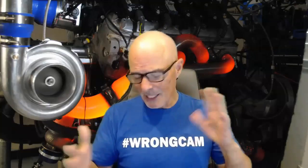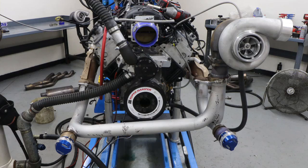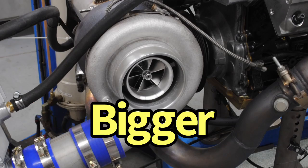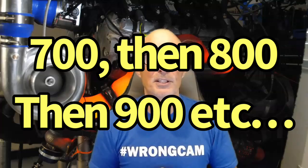Let's say you decide you want to make 700 horsepower with your turbo 5.3 — don't select a turbo that's maxed out at 700 horsepower. There's no reason to run a turbo at the ragged edge where it won't make 701 but will make 700. If you're going to make 700 horsepower, put a 1000 horsepower turbo on it. First, you can run the turbo in its sweet spot. Second — and possibly more importantly — you are going to turn this thing up eventually. Everybody does.